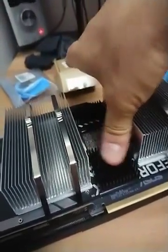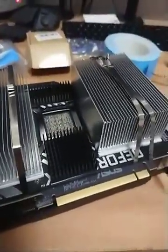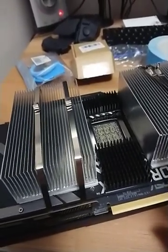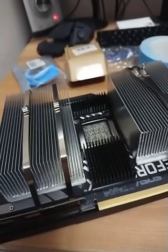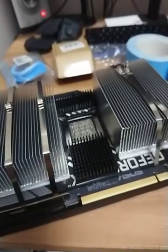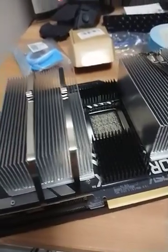The issue I've seen with the ASUS Strix so far is not necessarily the thermal pad quality, but the lack of pressure. Without doing anything, just when I applied pressure by hand, the temperature dropped from like 101 or 106 Celsius down to 96 or 94 — just from adding pressure. So they don't lack good thermal pads necessarily, but at some point I don't know how long the pads last. They start leaking eventually. The quality may not be awful — they just don't have enough pressure, and it varies depending on how they're built.